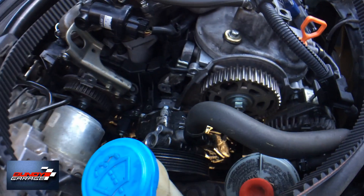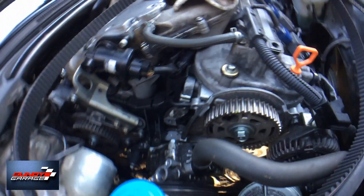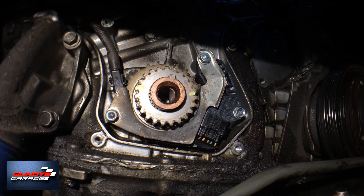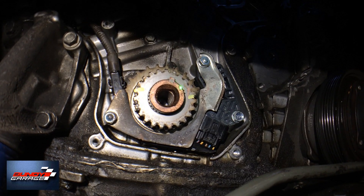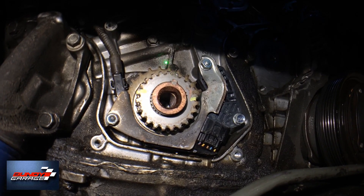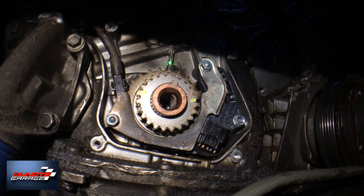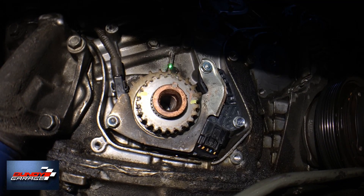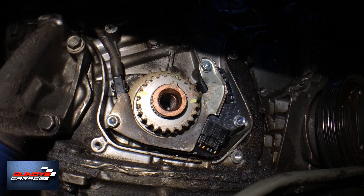Down below is a different story. Down here at the crank — this is where the crank pulley sits. Right here there's a mark right where the laser is, on the cog, and right up here there's another mark, an arrow. Those should be lining up, and as you can see, it doesn't line up. It's about one tooth off — maybe half a tooth off.